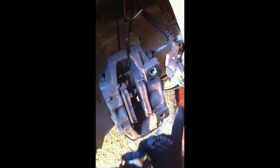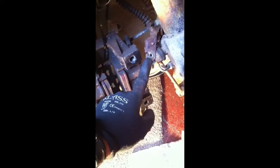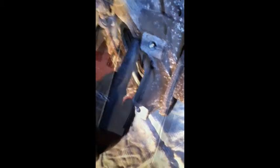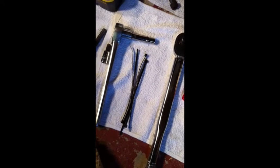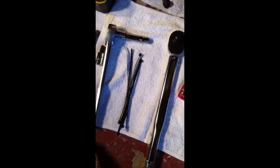Here's a picture of the brake caliper — I have it suspended using cable ties joined together. You can use a coat hanger; it's really just to keep it up and out of the way, as you don't want to damage your brake line by putting any stress or strain on it. Here is the clamp held on by the 10mm bolt, and it screws into the housing just to the left of the top hole for the caliper. That's why I've laid out cable ties, and then we have a torque wrench.